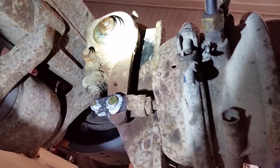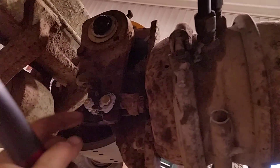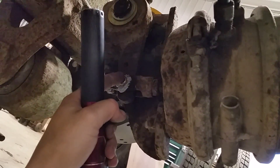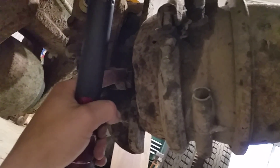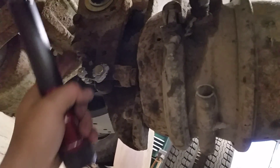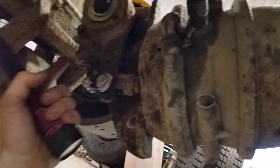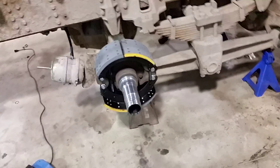So if you have to adjust your air brakes, something's wrong. Some of the most common causes for slack adjusters not adjusting are the S-cam pins here and here. If these are seized up, the slack adjuster will not work properly — all it'll do is flex this push rod when you step on the brakes, and you won't actually ratchet this mechanism here, which is the adjusting mechanism. That's basically air brakes in a nutshell — pretty simple.